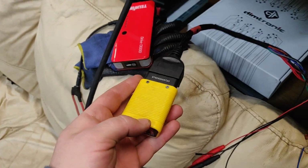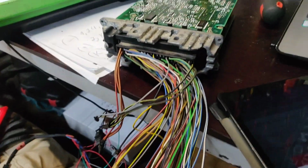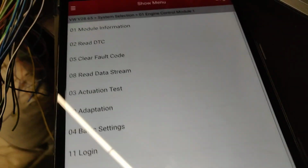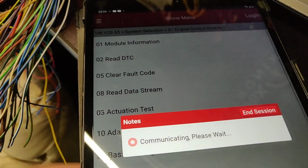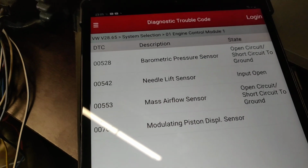So the conclusion of all of that, we connected to the diagnostics. We're already inside of the electronic control unit. One device on this side, and then the wiring like it was before, the same, nothing changed. And we can check if everything is correct. So let's click OK button. Then we can try to read the DTCs. So perfect, it's read the DTCs.